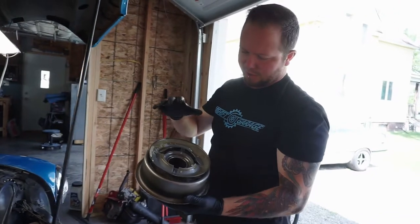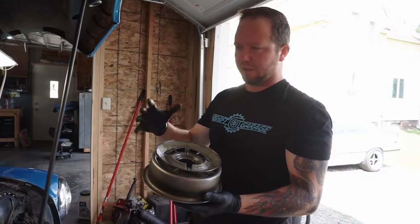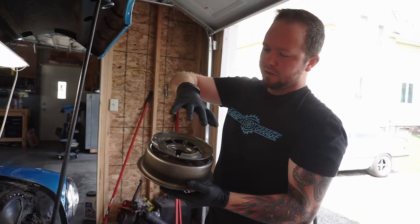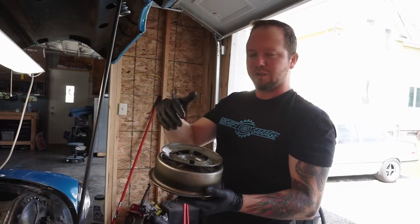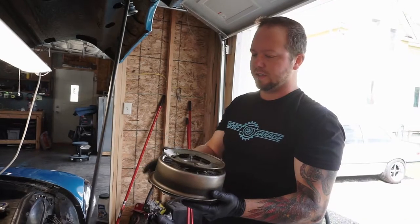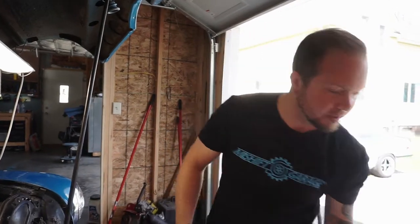Race cars are the craziest old thing. These use what's called an oil bath intake, like an air cleaner. If you look closely in here, there's a mesh, and beneath the mesh is a material that gets saturated in oil and acts kind of like an air filter. It's just the craziest thing. I'd never seen it before this. So you literally have oil in your intake.